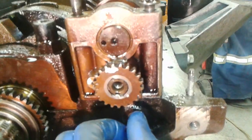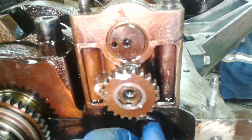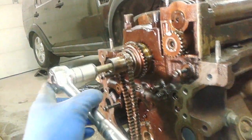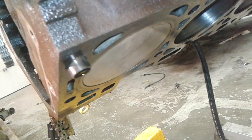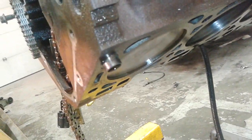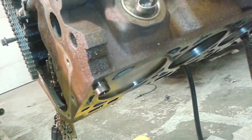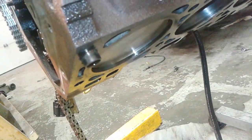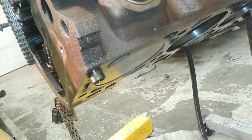So that's how you know that your balancer shaft meshes correctly with the correct timing of the balancer sprocket. The actual procedure to set the timing in relation to the crankshaft is to ensure that the number one piston is at top dead center. We can do that by rotating the crankshaft through until we just begin to see the number one piston crest the top of the block. Now we've seen it recede back into the bore, so we've gone too far. We're going to back that up a little bit and follow through the rotation until we feel we've traveled its maximum point and reach top dead center. This just requires some finesse — you don't want to put it too far.